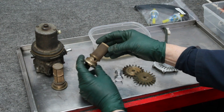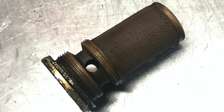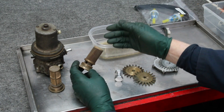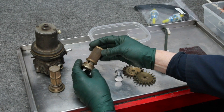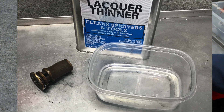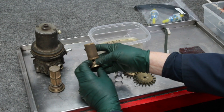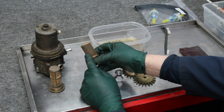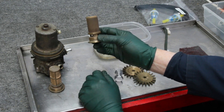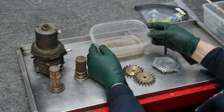These screens get really impacted with varnish. They may look okay, but there's a certain level of varnish — particularly if the cars don't get driven a lot, like a lot of these old cars that get parked for months on end. I recommend using lacquer thinner; it really does a great job of breaking down that old gasoline varnish and cleaning this screen. You can't tell whether it's dirty or clean just by looking — you have to put it up to the light at a window, and you should be able to see through it. This one you could hardly see through.